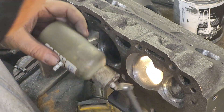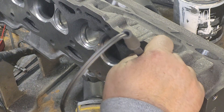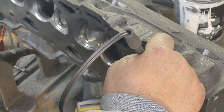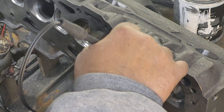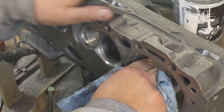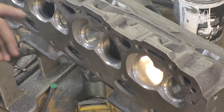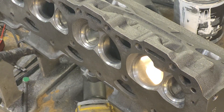Let's see how we're doing with our metal thickness. I think I'm going to take that down a touch more — even taking it down only makes it the same as the other side. I took off a decent amount of metal. We've got 150 thousandths there. You may want to ask why I always take the goo off after I sonic — because the goo I use is water-based, so if you use it on iron it basically rusts everything.